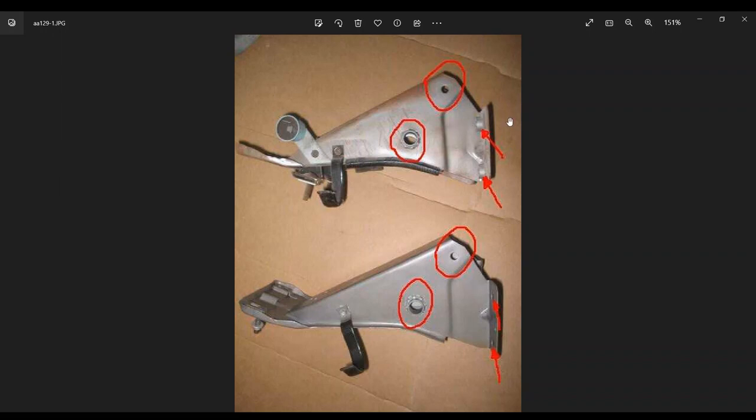There is a difference between these two brackets. The top bracket features welded-on nuts, so a bolt comes in from the firewall, through the nut, and holds it tight. The bottom one is from Ford — if you bought the car with power brakes, the studs on the back of the power brake booster just push through and you turn on a nut. Very easy to deal with.